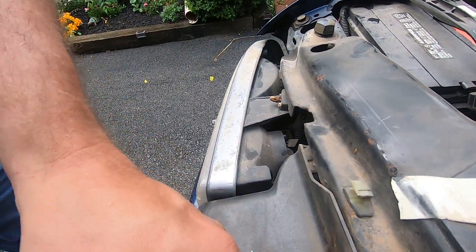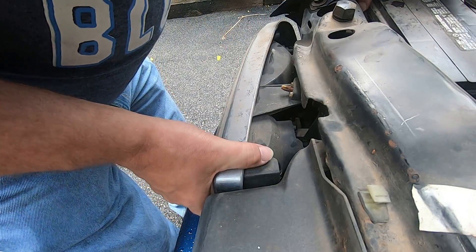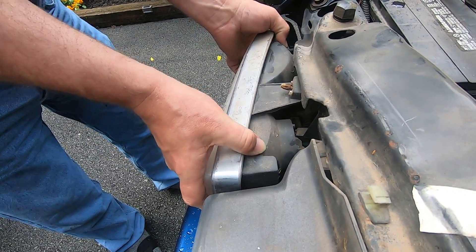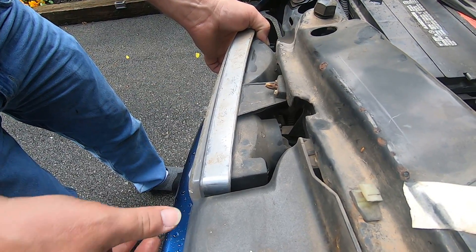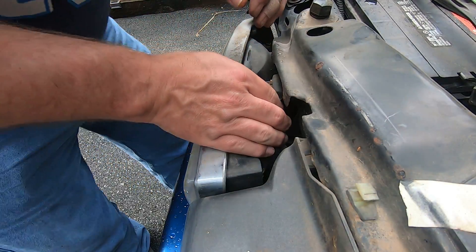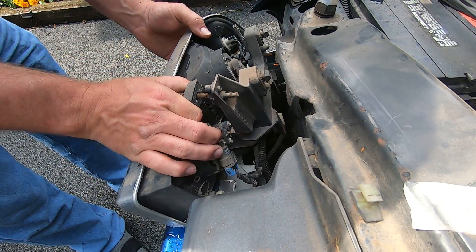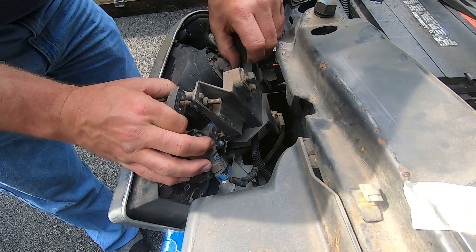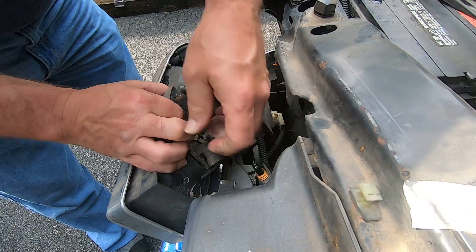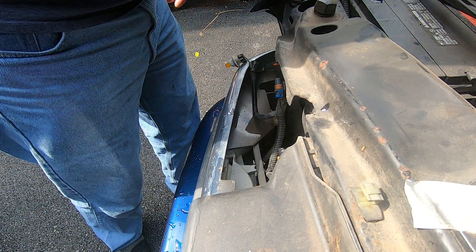This one I'm afraid of — I don't want to break anything. I'm trying not to knock the camera down because it's just sitting on the ledge of the grill. There we go, there we go. You've got to be real easy especially on these older trucks. Then pull that out, push them off — there we go. Then you have to twist this bulb out. Boom — I could not believe how easy it was to pull that.